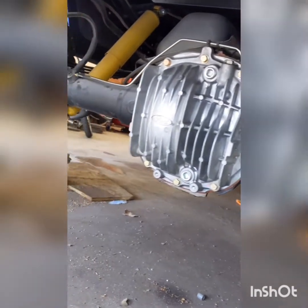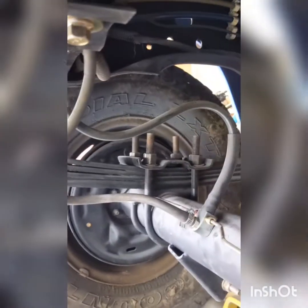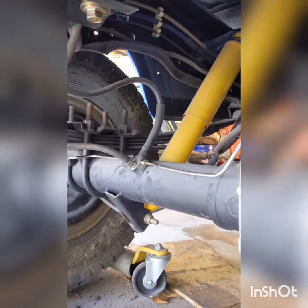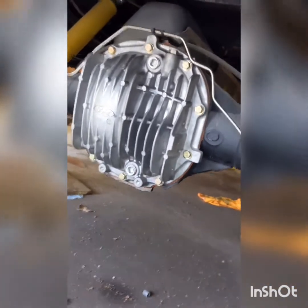So that's the rear. The only one I have left now is the one that runs along the frame that goes up here where this rear tube is, and goes up and along the frame inside there. I've got a makeshift one I started along there that I was going to put a compression fitting on, jerry-rig it up to the proportioning valve. I'm going to pull that out of there, and then I'll install the one that came in the kit, and then this will be a done deal right here. And as far as I can tell right now, it's well worth every penny.